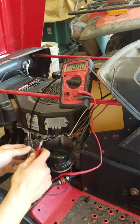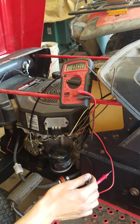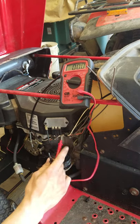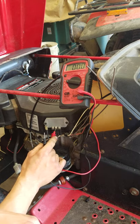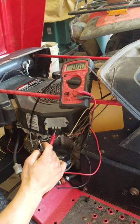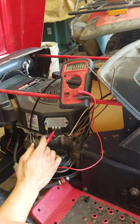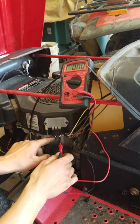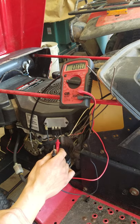First of all, we've got these two wires on the outside. Those are coming from your stator - they are AC inputs that this rectifier uses. I think this one's a 15 amp charging rate out of this center one. That center one gives you a positive charge that goes, for me, straight to my battery.